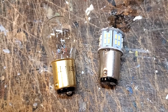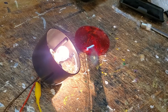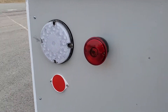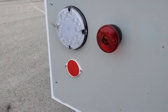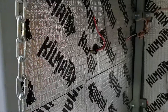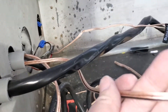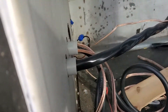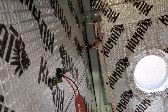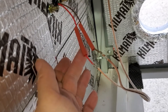90% or more of the electricity used by incandescent bulbs is wasted as heat. There's a test fit of the running light — still have to bolt it down and wire it in. I've snaked an additional pair of wires through the wall of the bus, through the conduit, down through the hose, and around. They're soldered and ready for the heat gun to shrink the shrink wrap.